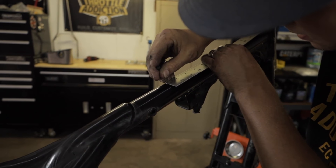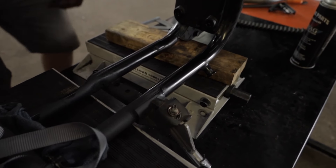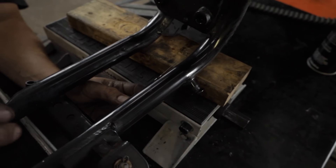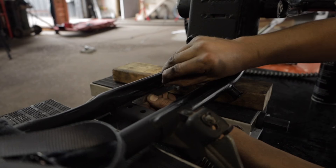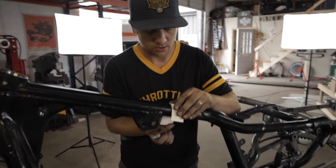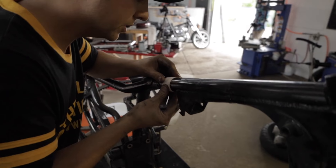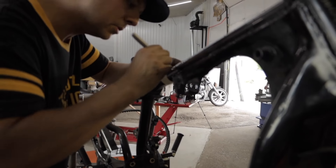So we're just using a straight ruler — 16 inches right there, grab a little mark. Down here we're coming off from the inside of this cross member two and three-eighths back. We're going to mark the line with a silver Sharpie, and then a little trick: take a straight-edge piece of paper and wrap that all the way around. If you line your two ends up, you know that you have a square cut all the way around.